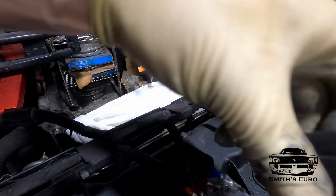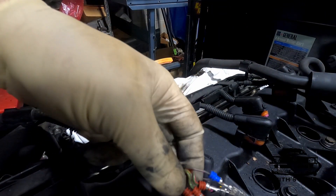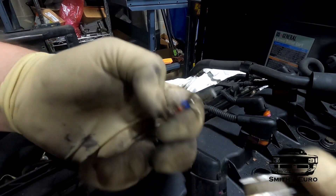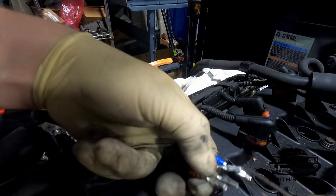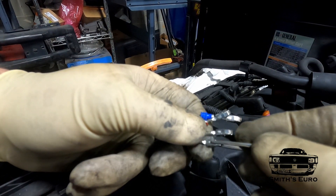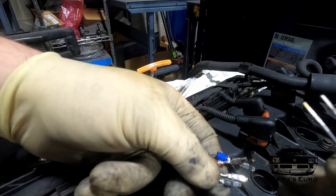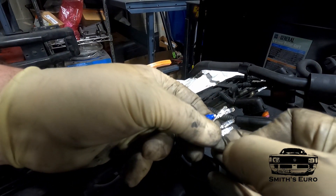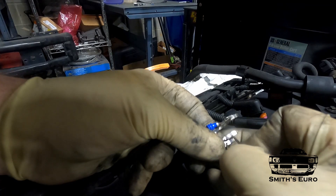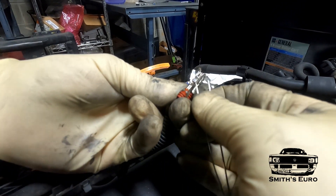All four connectors are out. When you pull the wires out they generally stay where they were — even though it's exploded, that's how they were. On these plugs there are little tiny tangs — here's a tang, here's a tang. What you're doing when you put this tool in is just compressing the tang — compressing it down. Now you have to push them back up a little so when they go back in they lock in place. Just enough — if you break your wiring, that's on you, not me.